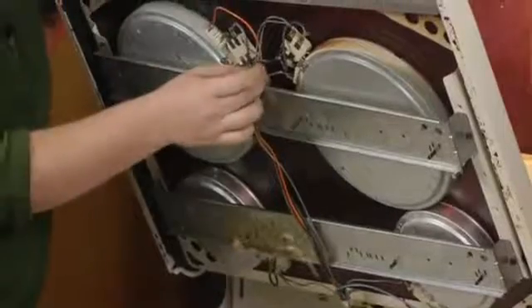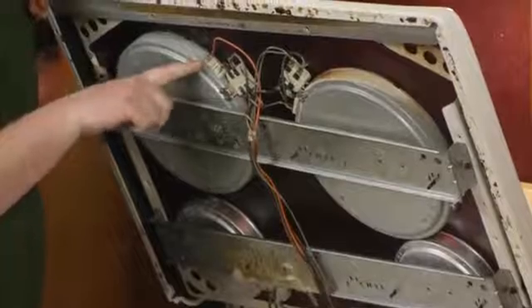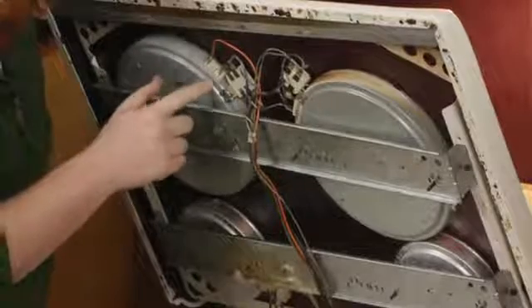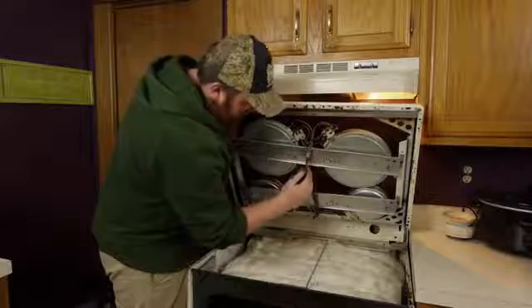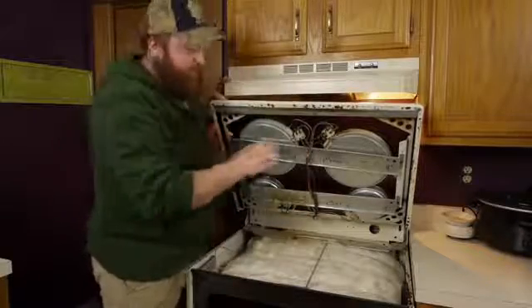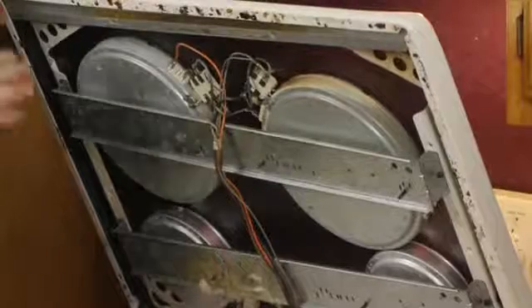The number one reason to check your wiring is for burn marks. You want to go through and make sure your terminal ends aren't charred and don't have burn marks on them. Also, look at the porcelain around it — make sure there aren't any sparks thrown there with burn marks. Run it all the way back down into the back, checking each terminal, because a lot of times these terminals can't handle the juice running through them, so they'll actually spark the part.